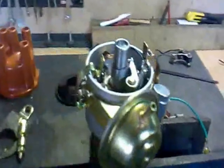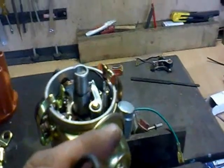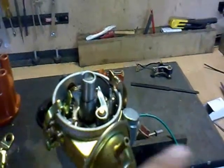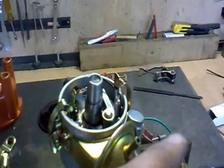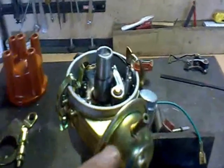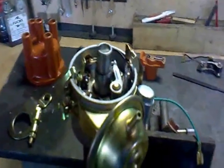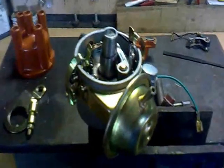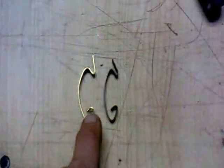I've given the diaphragm a vacuum test — you suck the air out, hold it, and then let go. It should spring back. If it droops back of its own accord while under suction, you've got a leak and it's no good. We're going to use the standard condenser, set everything up nicely, get it running on a known same system, and see how it performs. On those clips, we're going to improve the curve so they spring more nicely and are easier to use.